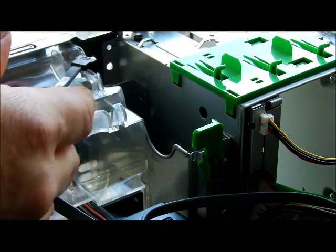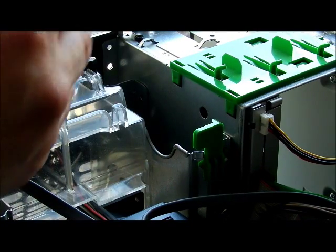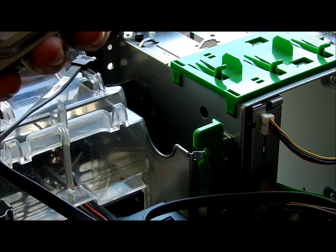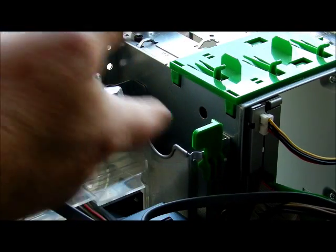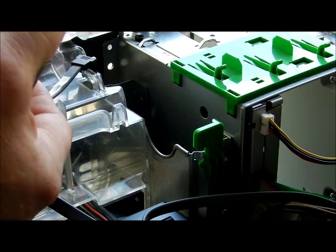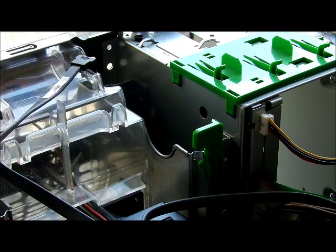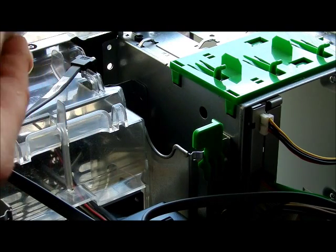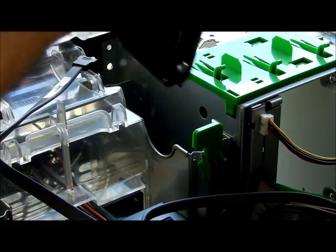When you get your replacement hard drive, it could be a little thicker — you do have room in there. This one is a 160 gig. You can probably go up to 500 gig or even a terabyte — check HP's website to see what the maximum capacity is allowed in the BIOS. Take your four screws out with a flathead or star driver, put them into the holes on the sides of the new hard drive, and pop it back in.